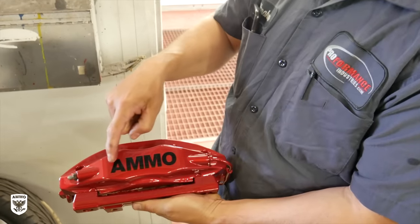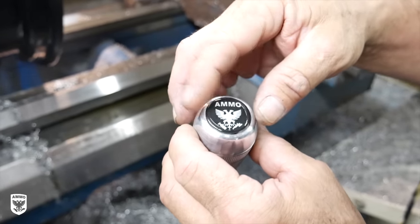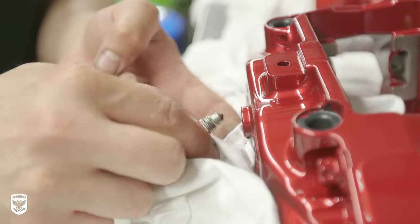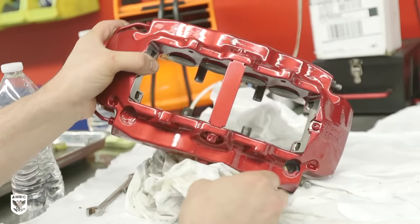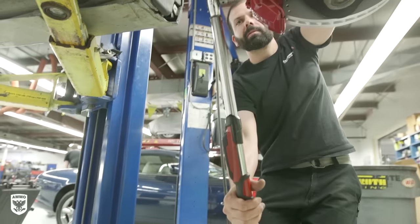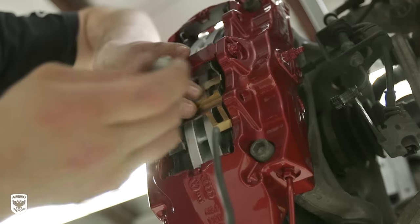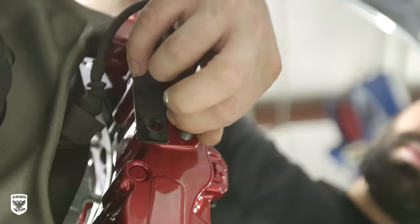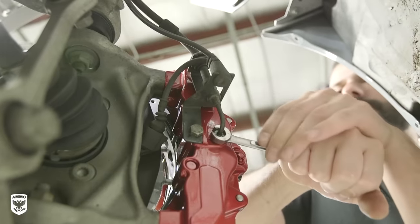The next day, they were ready to be packed up with the new wheels and shifter knob bound for SST Auto in Danbury, Connecticut. Once they arrived, I removed all the masking tape while Mike unscrewed the temporary brake bleeders to prevent overspray on the threads. Then he compressed the pistons fully while trying to minimize any leftover brake fluid from leaking out onto the fresh paint. Once ready, the calipers are attached to the hub with two bolts and torqued into place. The new brake pads are inserted and connected to the brake line sensors, and the new pad retaining pin and anti-rattle spring are installed. The brake line is carefully reinstalled to avoid drippage, and the process was repeated on the remaining three wheels.